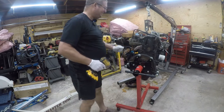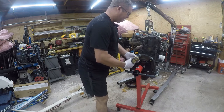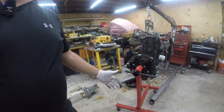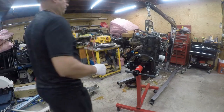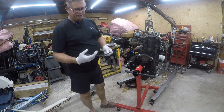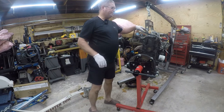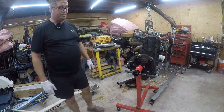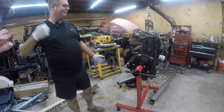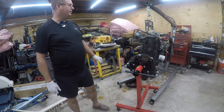Yeah. Need a new one of those. Okay, there's nothing going on here that couldn't have been addressed on the hoist, but it's a lot easier to do. So that was half sheared. And if there's one thing that will cause you no end of grief on a Jeep, it's electrical system issues and ground problems. So spotting something like that and going, the hell with it, let's rip it off there and we'll get another one on eBay.